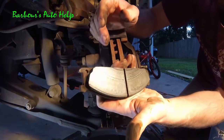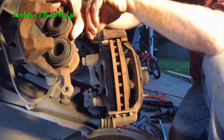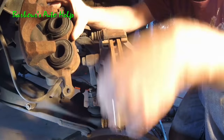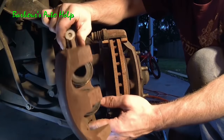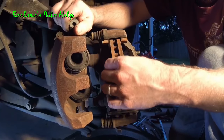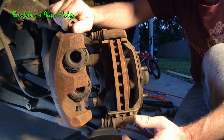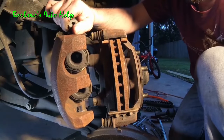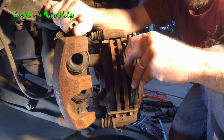That's pretty well burned up. So we saw that our slide pins are sliding freely, however there is some play in them so we're definitely going to replace those. But I'm still curious about these pistons — they seem very resistant going back in. I didn't get a good bite on that rotor to push them in with the screwdriver and pry bar. Now that the brake pad is out on the backside, we'll have enough room to put our pry bar in and adequately test that.